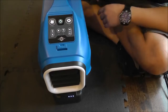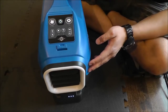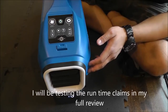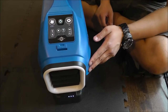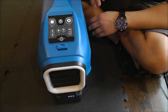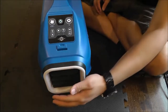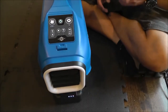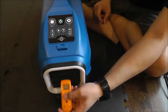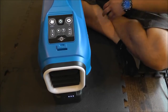Of course you want to see the main feature again, which is the AC. So now we're going to be running this air conditioner off of a battery, which is slated to last five hours on medium fan according to Zero Breeze. Started up — it sounds exactly the same as running on AC power. I noticed zero fan difference, zero compressor speed difference. The air coming out the front is just as cold. The room is reading 74 degrees, we're getting 65 from the front, and an exhaust temperature of 83 degrees.